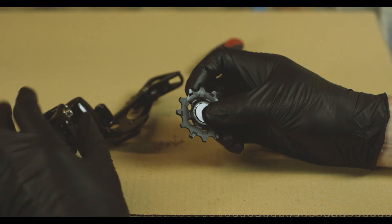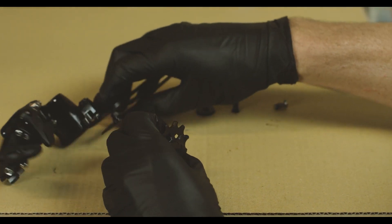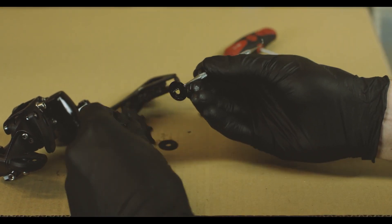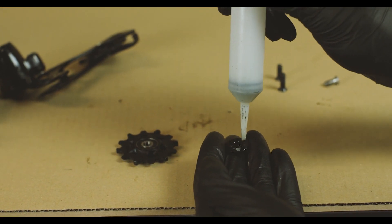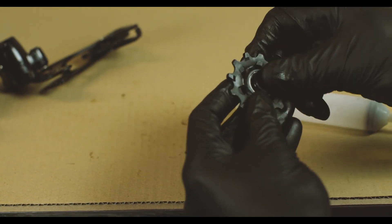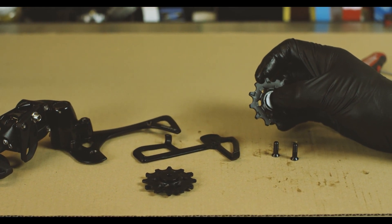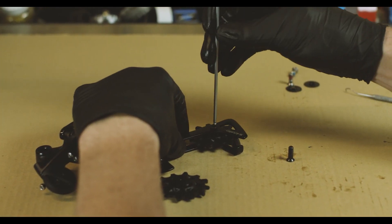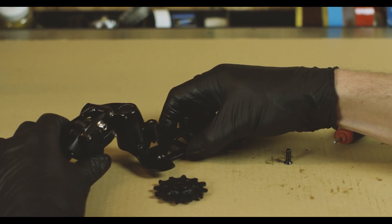Now we're going to replace this front plate. You can tell the difference because the one on the back doesn't have a little lip on it — it's more like a washer — and the lip is actually on the cage itself. We're going to replace the one that looks most like our spacer, which has a little lip on it. Lightly grease the replacement plate before installing. Now we have the pulleys all set up and can reinstall them. Your E13 kit should come with two bolts, one longer than the other — we're going to install the lower pulley first using the longer bolt. Leave it a little bit loose so it's easier to get the other pulley in.